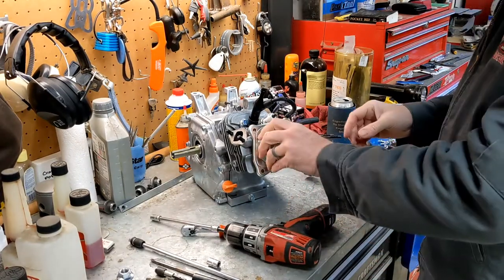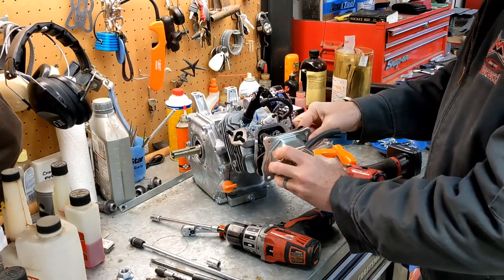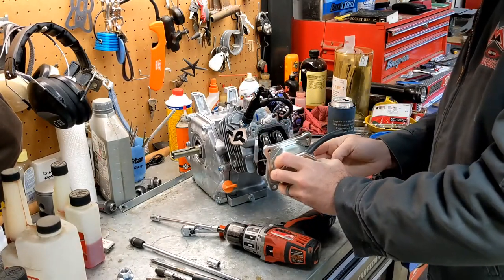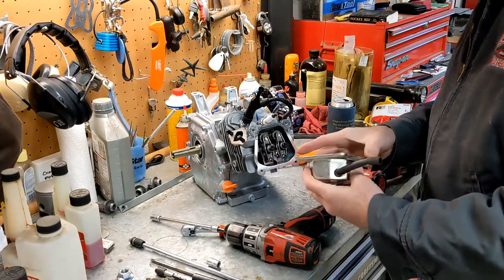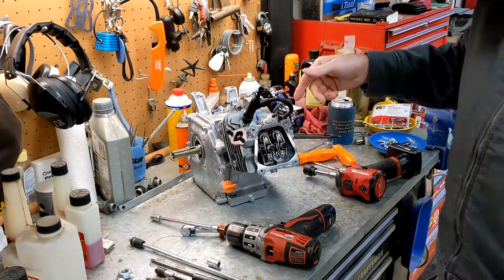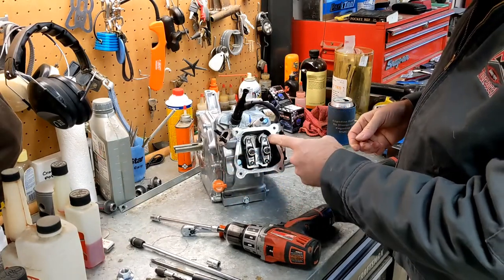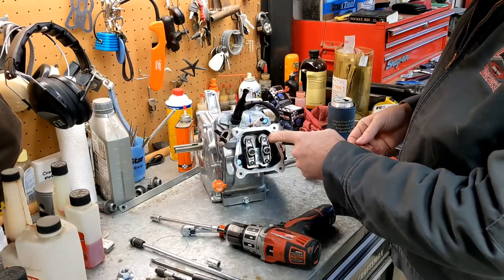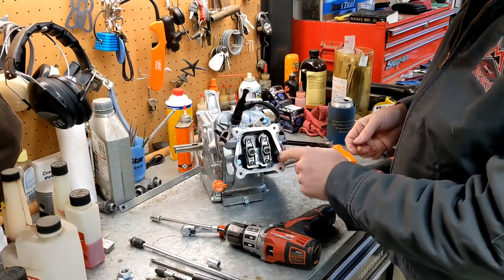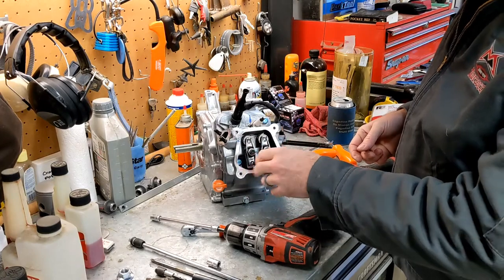All right. Valve cover off. Careful with the valve cover gasket. You should probably always use new gaskets, and I think I got a new gasket in the set, but if I don't, let me just reuse that one, hang on to it. All right, we've got our four bolts here, our rockers, valve springs, and this head. I'm going to port this head out some, so I'm going to take all this stuff off so I can clean it after I get done grinding on it.